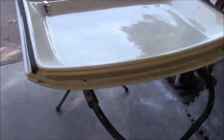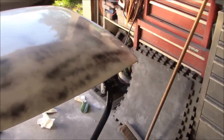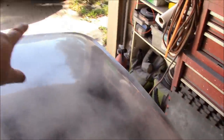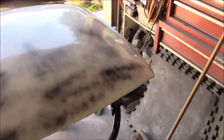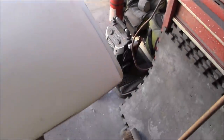The underside is now sanded down to 240 grit, ready for a coat of primer. The top side — I've decided to guide coat and sand to see where our lowest spots are, then determine how bad it is. I know there's a bad area over here that could use some filler. We'll just see how bad it is before I decide whether I want to add filler to this top or not. If it's minor, we'll probably leave it; if it's major, we'll probably fix it. The top of the hardtop is sanded, and I suspect I have a few little waves here — you can see where it's left the guide coat. We'll break out a bit of filler and do these areas. The rest of the top is not too bad, so let's fix up those spots and then move on to getting this into primer — probably epoxy primer first before we hit it with some high build primer.